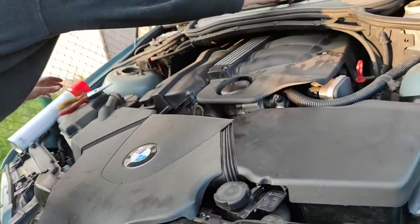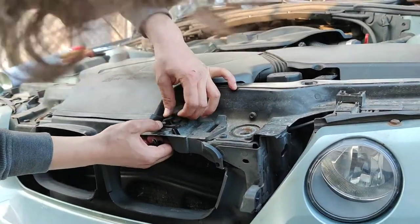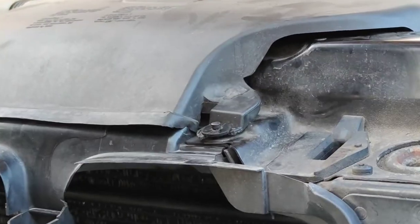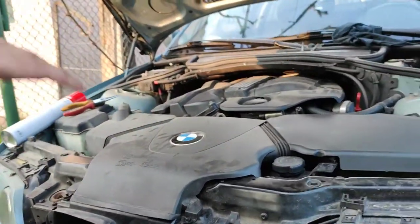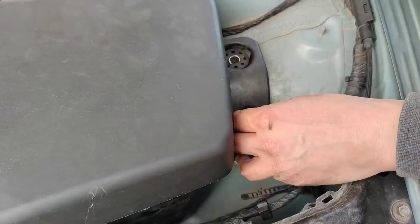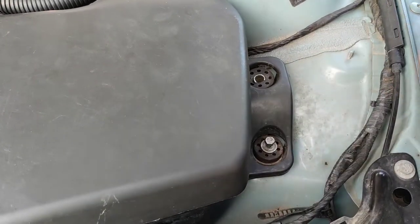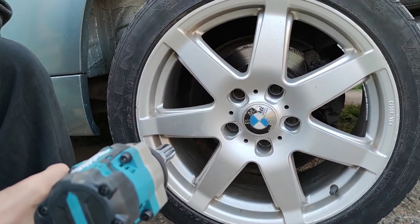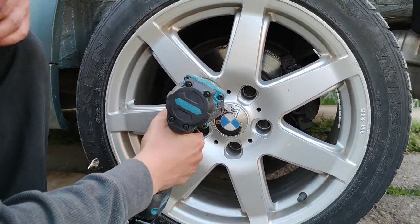This one is broken but it still holds. We're done with the engine side. Before moving to the brake disc on the back of the car, don't forget to put back the two bolts holding the air filter box in its place. Starting with the brake disc on the left side — in order to do that I jacked up the car first, and then using an impact wrench I'm going to open the bolts holding the wheel.